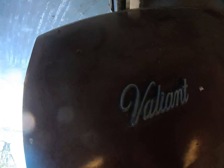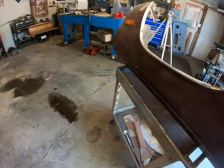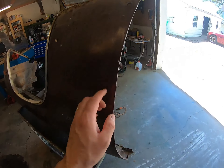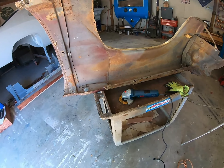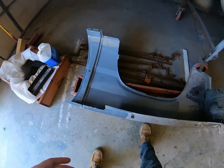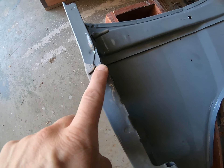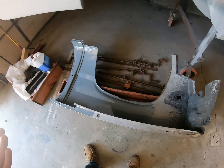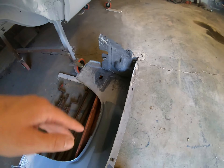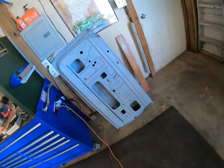This one here is not the one going on the Duster — it's one of the old Valiant fenders that the Crawfords brought us. It's got some heavy damage, a lot of Bondo, so the fender is not great. There's a bit of rust up here, which is fixable, but it's a parts fender at this point. We need to cut this little section out because on the fender we are using, that area was rotted out, so we're going to cut, splice, and weld it all back together.